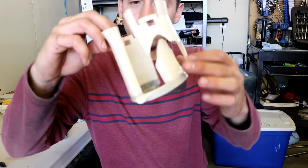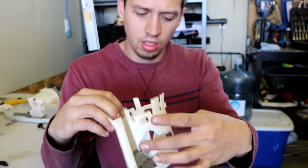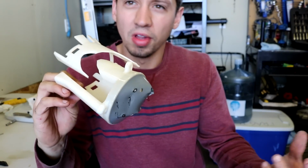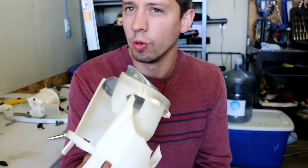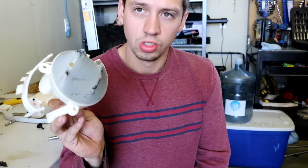Alright, so what I ended up having to do is, in the tank there's this baffle. I kind of broke it to shit, but it was spot welded on the bottom, 4 spot welds. And basically it just gets in the way of everything. So you have to pull it out, unless you have an 03-04 Cobra tank apparently, where they are made for dual pump hangers. So we just pull this out, and then you gotta run more than a quarter tank of fuel because it's gonna slosh around a lot more now.